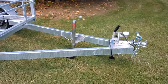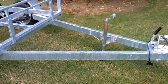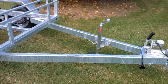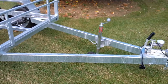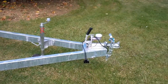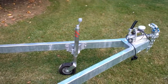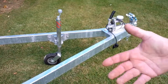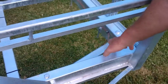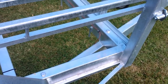Starting from the front, we've got a 1.7 metre drawbar. The trailer itself is a little over 4 metres long. The drawbar's in 5mm steel — very high quality steel — all New Zealand made steel throughout the whole trailer. There's a high capacity brake reservoir, a very strong jockey wheel, and in the case of the drawbar, just to show you the quality, stainless bolts where it's bolted and welded, to give that extra strength.